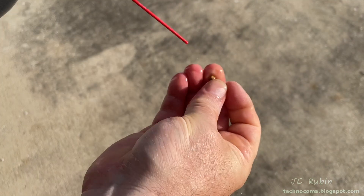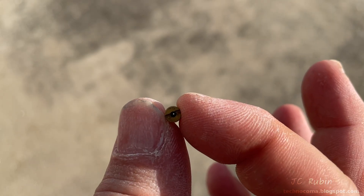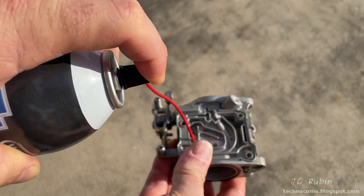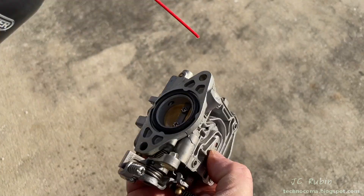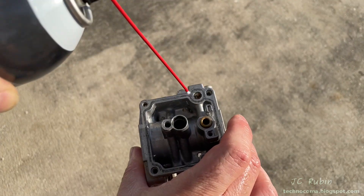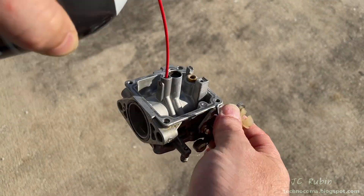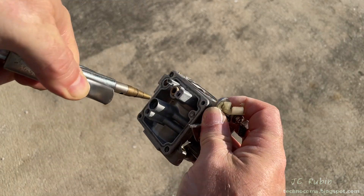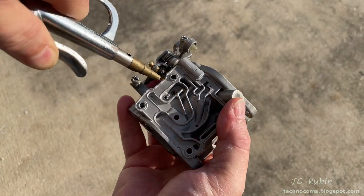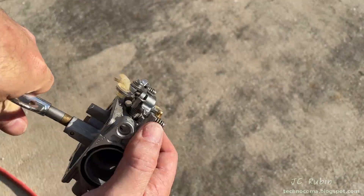On these smaller pieces, hold on to them with dear life especially with the air, so they don't shoot across the driveway and force you to buy a new one. For the 39 pilot jet, spray through both sides and blow out with air — the hole didn't get smaller. Now we go through the carb, spraying every single passage with carb cleaner. The O-rings are still in on both sides only because the O-rings haven't been ordered yet — I don't remove the parts until the new parts have been ordered. I cannot stress enough the importance of this. We blow it out with air and want to feel the air come through passages out another passage, confirming no blockage. Taking my time, making sure everything is nice and clean.